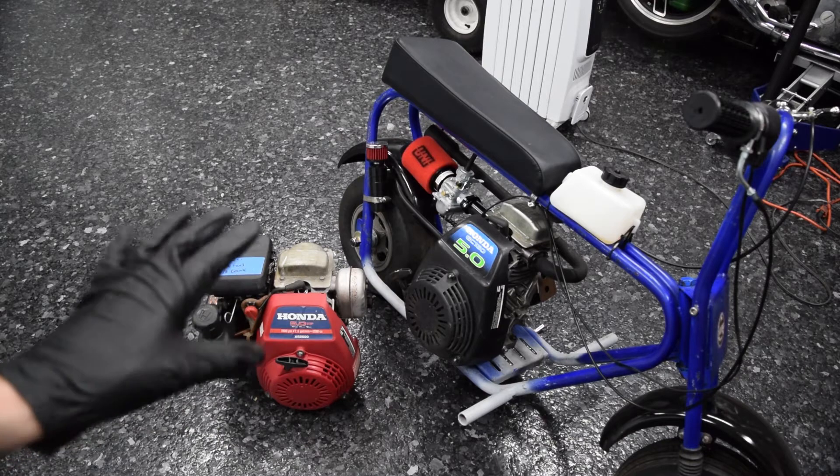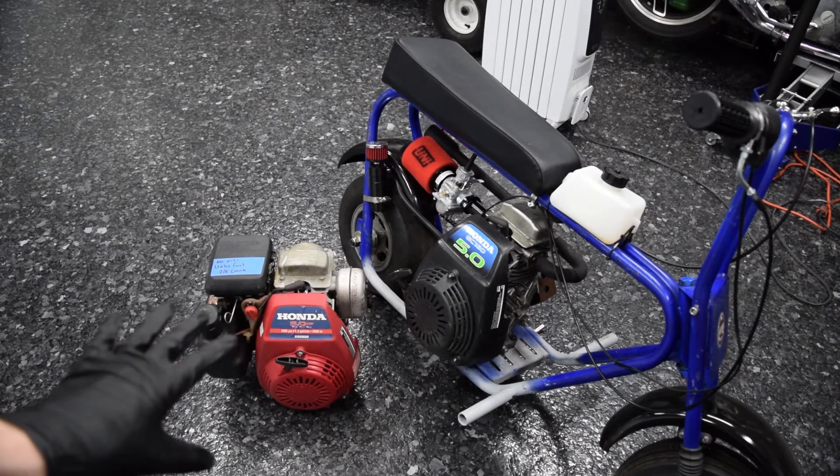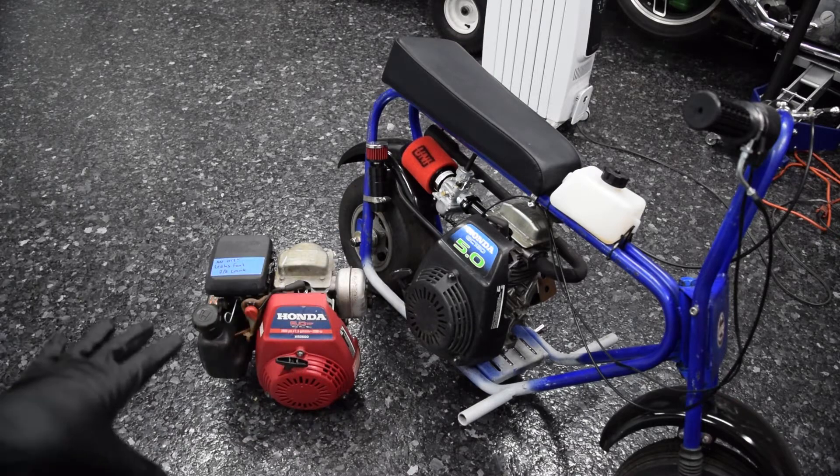The result of that is this one has a useless crankshaft which you can't find any sort of clutch for. So this one is ultimately useless for a go-kart or minibike. I want to show you how to fix that. We're gonna end up throwing away most of what's on here because the exhaust and governor stuff are all in weird locations for a go-kart or minibike application.